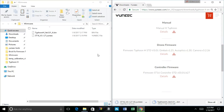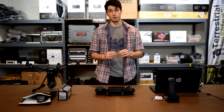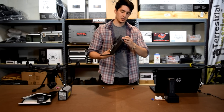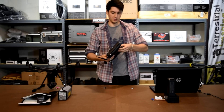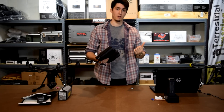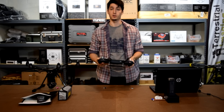Once you're all set and you have this, we're going to show you how to go about updating. First, we're going to update the ST16 controller, then we're going to update the drone. So now that we have our firmware, we're going to take it and use that microSD card and put it in the bottom of the ST16 controller. You'll see on the bottom there is a microSD card slot. One thing I want to point out is that it's a pretty small port and it's pretty springy, so you've got to make sure that you get that click. If not, your SD card is going to go shooting out. But once it's snapped in and all good to go, we're now going to go into the controller and go about doing our update.